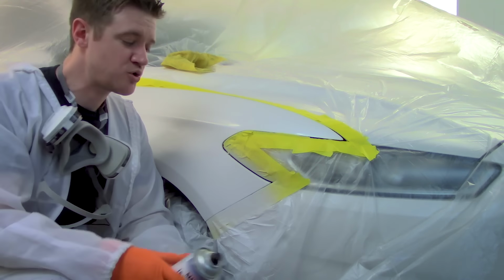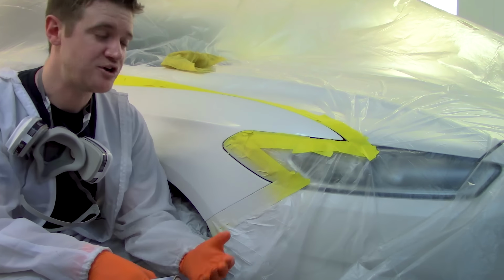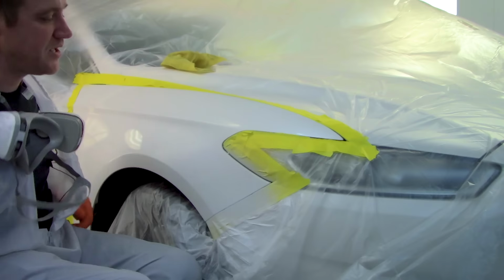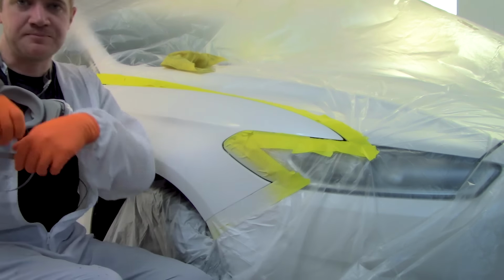But what you have to do with tri-coats, if you want to get this match dialed in completely, is do what's called a letdown panel. So I've got other videos on that as well. I will make sure they're all marked in the description so you can find them. But okay, let's get the mid-coat on.